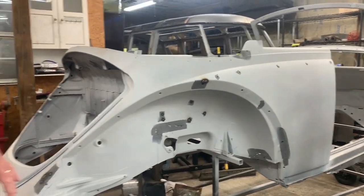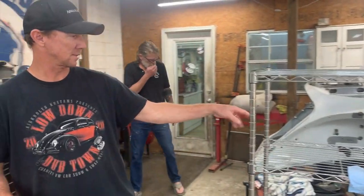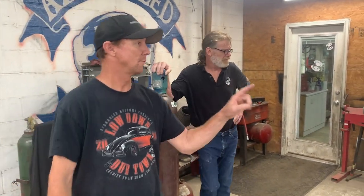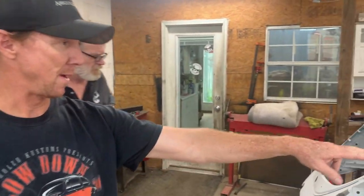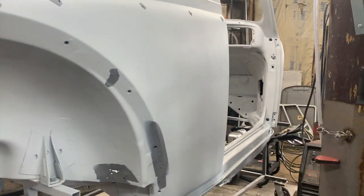Yeah, those are the convertible to go. We're going to sit here in a holding pattern because we were waiting on panels to get it all going together. And next is a bunch of cutting apart. When we start that, it's going to be pretty elaborate because, being a convertible, the main piece we have to replace is that heater channel and support, which is holding the two pieces of car together.